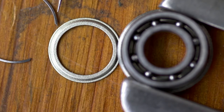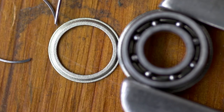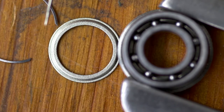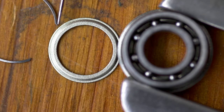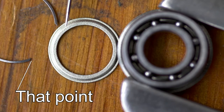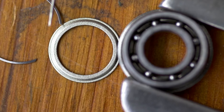There's the shielding and the retaining clip. The retaining clip — you can kind of see that there's a notch going one way. Not really a notch, but it's cut at an angle one way versus the other. You want to pry on the side that has the point kind of going out a little bit, just so you can get a little bit of leverage in there when you're prying it out.